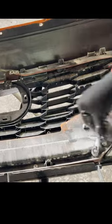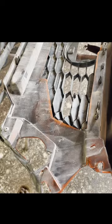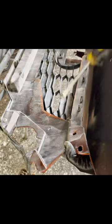Take out the bottom screws for the grille — total four screws. The fifth screw is towards the fog light side. Another screw at the very top also needs to be taken out. On the other side, there is damage. To take out the grille yourself, here are the screws you need to remove. All the screws are now taken out.